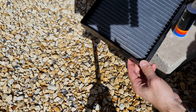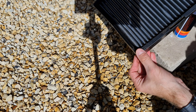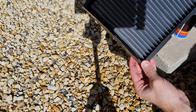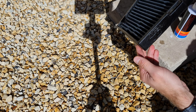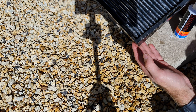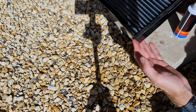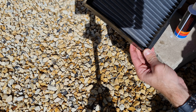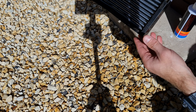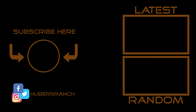Now we're going to reinstall this in the car, and that's it — that's how you wash and recharge your K&N cabin air filter. All in all it takes approximately 45 minutes from start to finish, just because you have to let stuff soak and dry. K&N says you should do it every 12 months or 25,000 miles, whichever comes first. With me it was the time — about a year and a half since I installed it. I hope this video helped you guys; I'll talk to you in my next video.